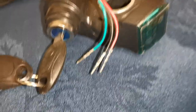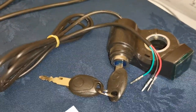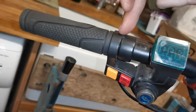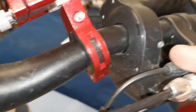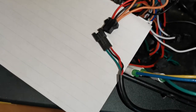Be sure to get the order correct because else things could go wrong very badly. If you get the whole mechanism and you don't have a soldering iron or don't feel confident using it, then you would remove the handlebars, the switches, the brake lever, and then release the grub screw on the back of the key switch unit and take it off. You'd also need to liberate those wires from the plastic connector.